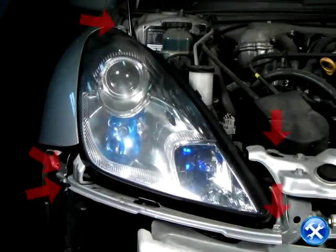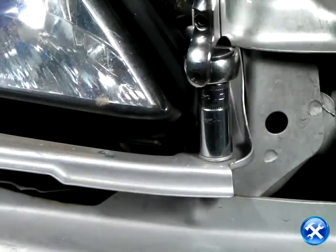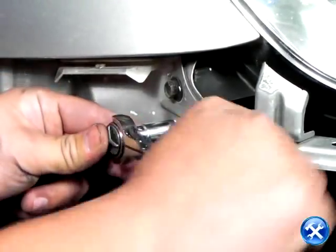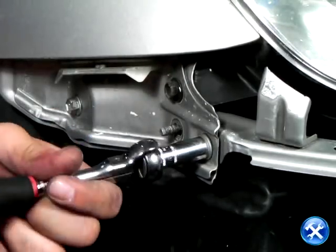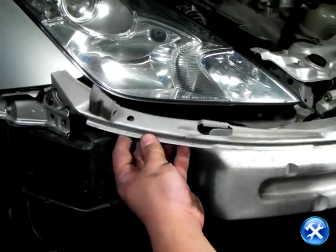In this shot, there are five more red arrows and five screws. Please remove the screws indicated here, starting with the bottom. Since the bottom is a bracket, we can start from the inner to the outer. Once the screws are off, please take off the bracket carefully.